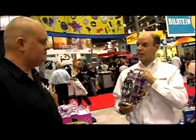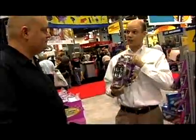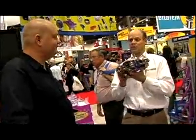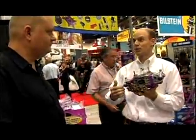And just as of right now, here at the SEMA show, we are releasing our new 750 Circle Track race series carburetor, which also has the purple features, but has special circle track race modifications like wedge-shaped fuel bowls. Exactly. So when you fly around the track, the gas doesn't all end up on one side.